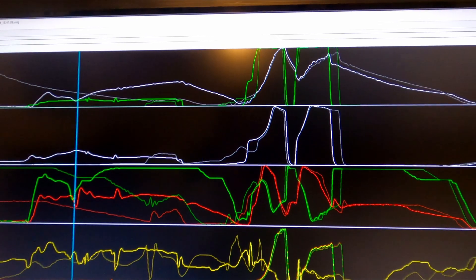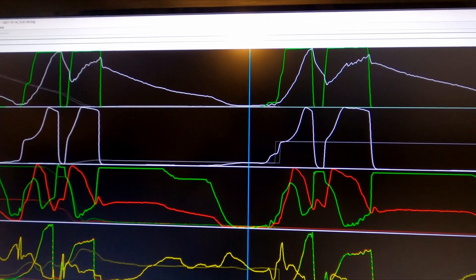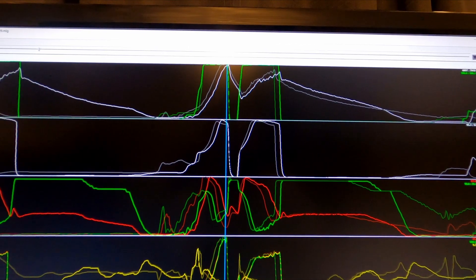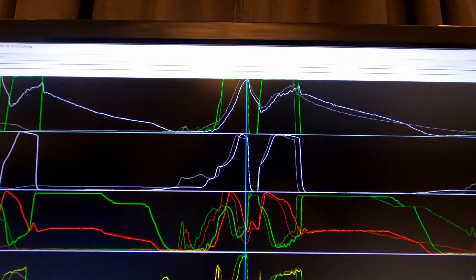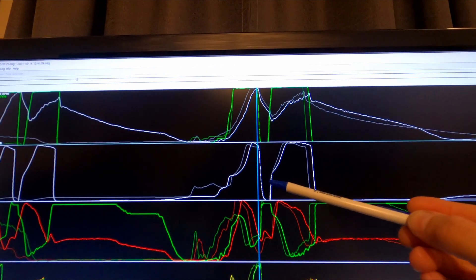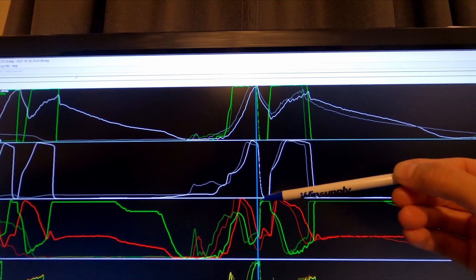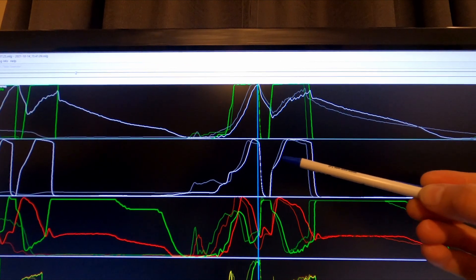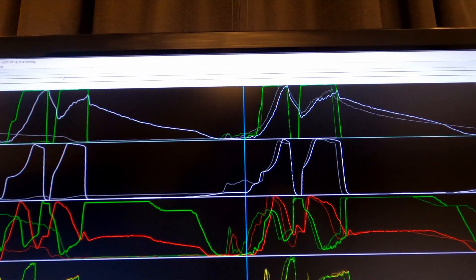That's our first event — let's keep going down the line. This is our second event. I've got both second pulls lined up. The most important thing is that when I was getting back on the throttle, these two green lines match identically. Now in this case — remember, the light gray line is where I'm venting to atmosphere — we blew off identically, the exact same amount of pressure. But in this case, I was actually getting more boost pressure quicker with the vent-to-atmosphere setup. But it could just be an anomaly, so let's keep going.